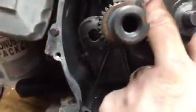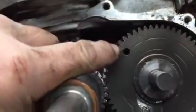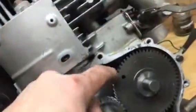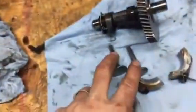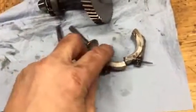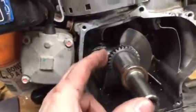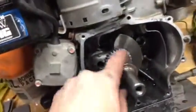When I go to put this back together, I'm going to pull the camshaft out. There's the mark right there, right in between those two teeth. And then the crank — there's the dot on the one tooth, one tooth fits in between these two. I just pulled the camshaft out; two lifters fall down. There's the end of the broken rod — it actually sheared the bolt off as well, so I'm going to have to get a new bolt. The only way to get the crankshaft out is to pull the recoil off and the flywheel off, then I can pull this right out and have a look at the journal.